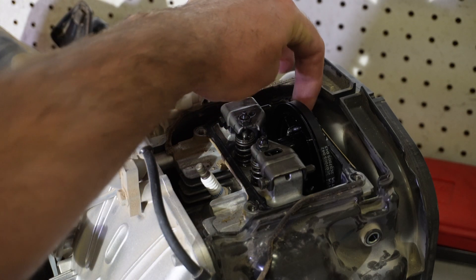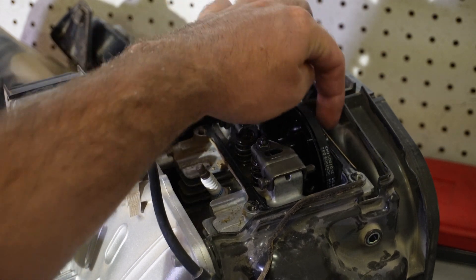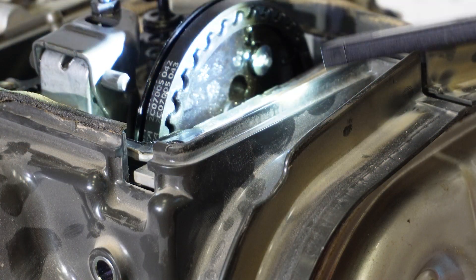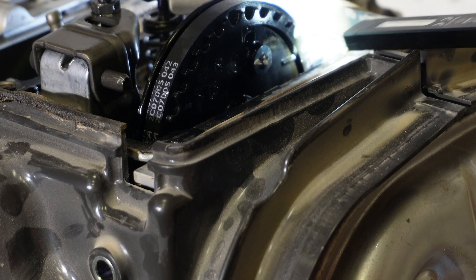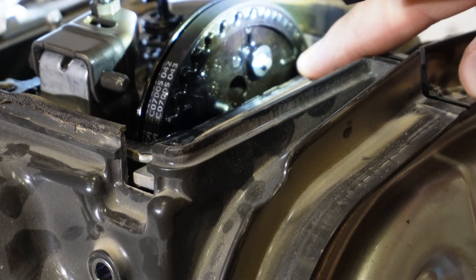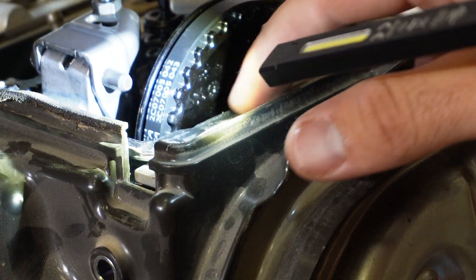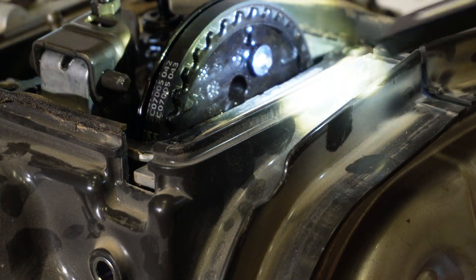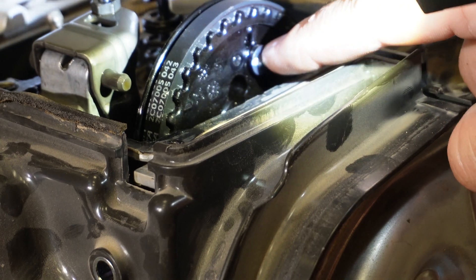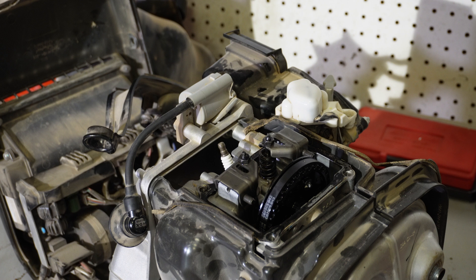I forgot to mention: when making sure you're at top dead center, there are two notches on the backside of this cam gear that line up with the top of your valve cover. If you look, you can see it — there's a flat line on this side and a flat line over here too. You want to see both of those lined up with this reference point. When those are lined up, you're at top dead center. If the line was up here instead, you wouldn't be at top dead center. And that's it for how to adjust the valves on your EU 2200i generator.